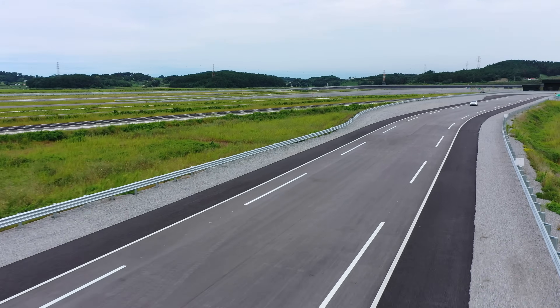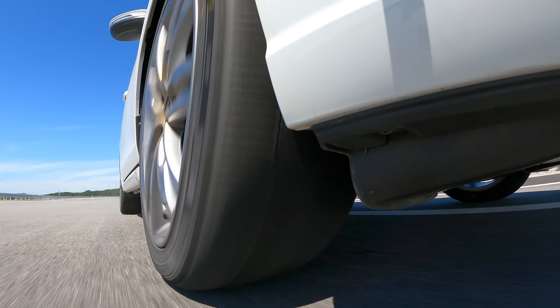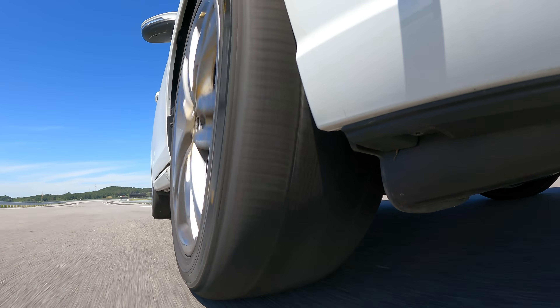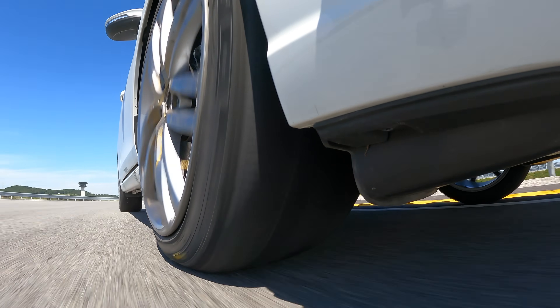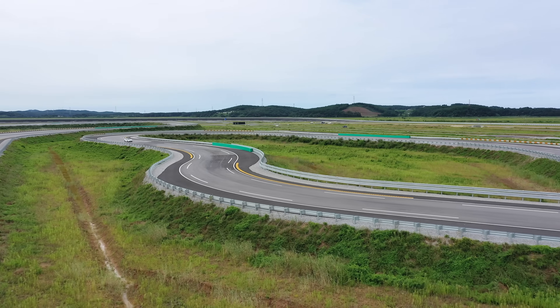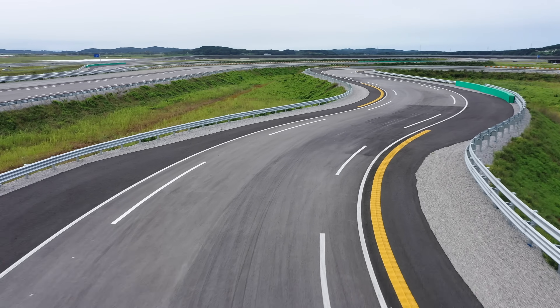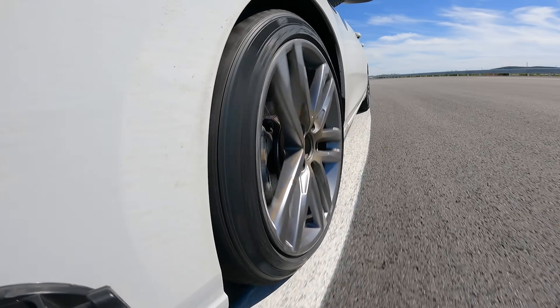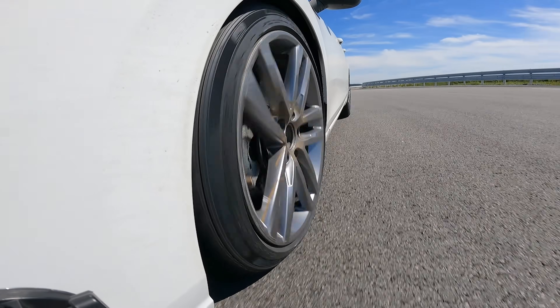Because I don't want to spend this entire video being mean about run flat tyres, I'm going to start where I think the run flat has the best chance and that is dry handling. I know BMW famously won't fit run flat tyres to their BMW M cars - their ultimate handling cars - and I've always wondered why. Because in theory a run flat tyre with its much stronger support in the sidewall will give you better steering response and better handling qualities, and I'm happy to say my theory is correct but not quite as I expected.